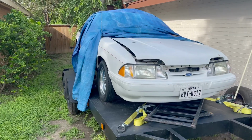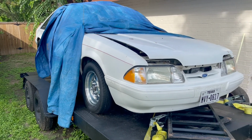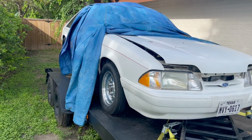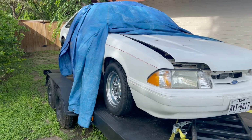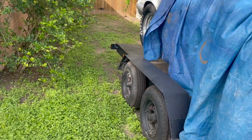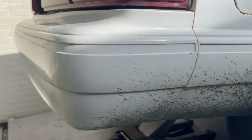Well, basically, what happened was the S hose in the tank slipped off, connected it, boom. But I do have some footage of that when I did it, so we're gonna go ahead and add that right there. Hate to see the car like this, guys, but a few weeks ago when we did go to the track, we only made 2 passes and the car didn't turn on no more. No fuel pressure. It was only picking up like maybe 10. It would crank up real quick and then die because the pressure would fall off. I can hear the pump turning on. So what I'm thinking is that something inside the tank came loose. Maybe the S hose.